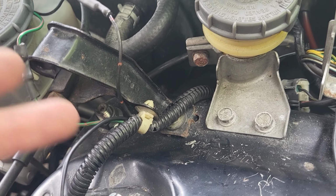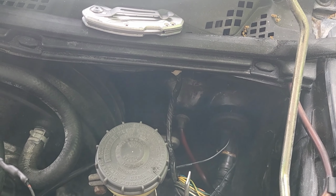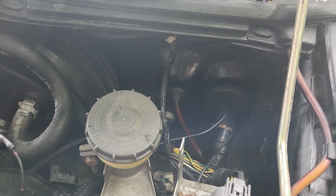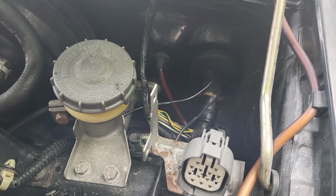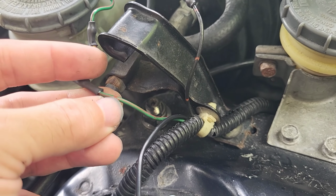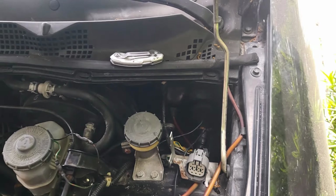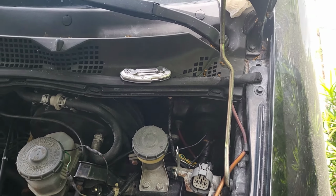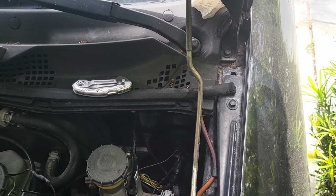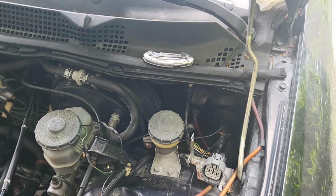So essentially this is going to go down to that plug underneath, to the other side of the conversion harness plug, which I'll go down there to get everything. Then you look up pin 18, which is green and red, and that's also going to be sending the signal to the ECU, because your conversion harness most likely doesn't have it, unless it's the Hybrid Racing one, which I know for a fact allows you to run that and has it. But this is a poor man's way of doing it, and I'll see you guys.